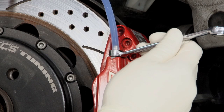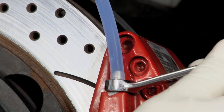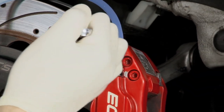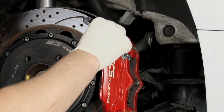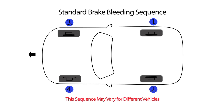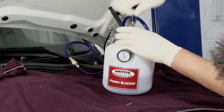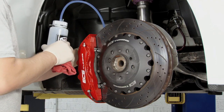On complete system flushes, switching between conventional color brake fluid and colored brake fluid like ATE Super Blue lets you see when the fluid change is complete. Hand-tighten the bleeders but do not over-tighten them. Replace the protective rubber cap on the bleeder to keep it clean. Repeat this process at the other rear wheel and then at the front wheels until all wheels have been bled. Maintain bleeder pressure and don't let the pressure bleeder run dry, or you'll pump air into the system. If you have more than one bleeder screw per caliper, follow your manufacturer's recommended bleeding sequence.